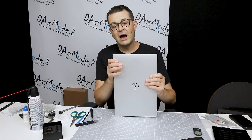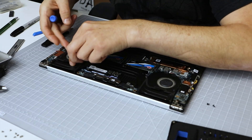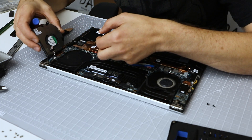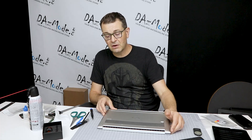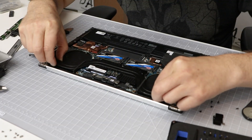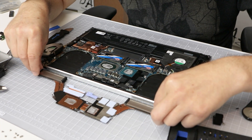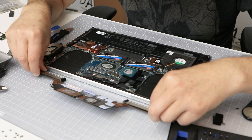I've spoken about this before — I wouldn't say that the thermal pads and thermal paste used in Dell products are particularly a piece of crap. It's just that they put something which satisfies minimal operational requirements. It works, but nothing special. And after some time it doesn't work as well. When I opened it up, I had no complaints about the installation. All thermal pads were properly installed and properly pressurized. Thermal paste was also applied properly — it was just hard as a rock, but other than that it was fine.